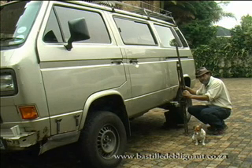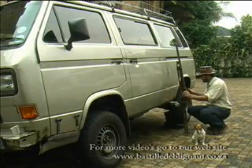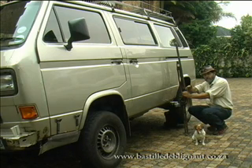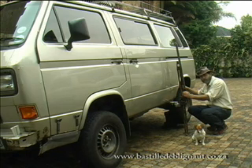Alternatively, we could do another test — the front diff lock test. We engage our front diff locks; both front wheels are therefore locked. So when we start getting spin on the rear wheel, power will be transferred to the front via the diff locks to the wheel that has good traction. The front wheels will pull the vehicle off the bricks that are underneath the vehicle.